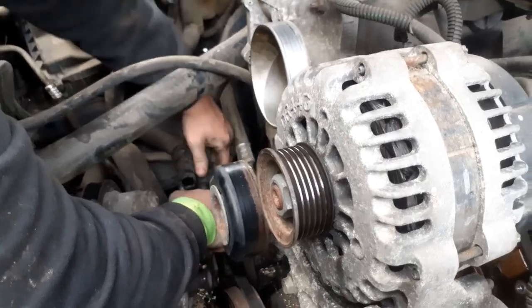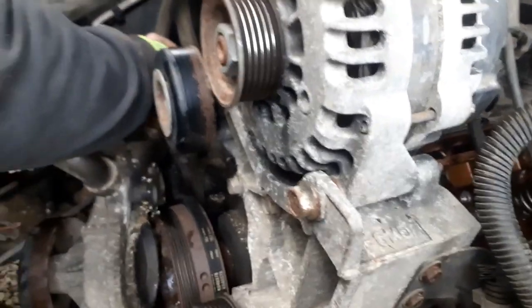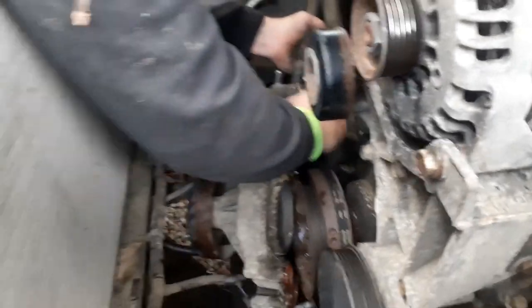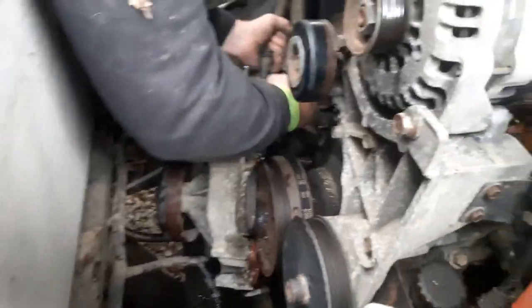You gotta take your heater hoses off, your hoses for the radiator, upper and lower shroud, the belt for the pulleys and your accessories, and then the belt for the air conditioner - there's a separate one for that. And we're going to try to pull the cam out without taking the radiator out. I've seen that done before on some videos, so we'll see how that goes.